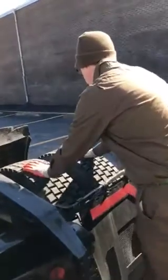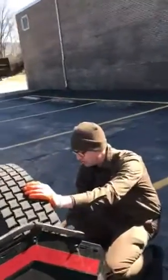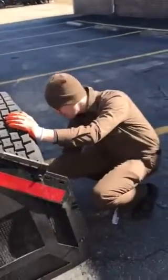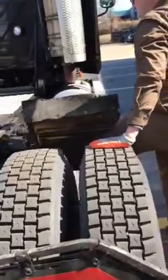Tires — minimum 2/32nds tread depth, no uneven tread wear, no stones or debris in between the tires. The inside and outside of the tires — no cuts, abrasions, bulges, or exposed cord or fabrics. Wheel has no rust or cracks, no missing or loose lug nuts. Sealed lubricant system — I cannot check the level, but it's not leaking. Metal valve stem and cap on the outside and inside. I checked for inflation with the back of my shoe.